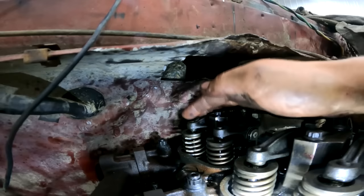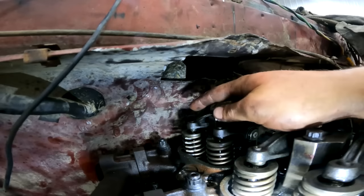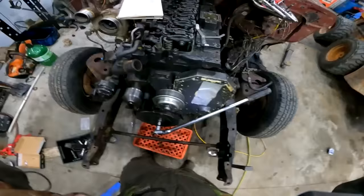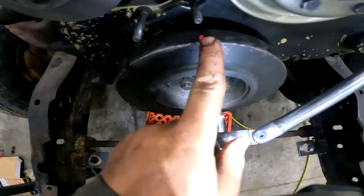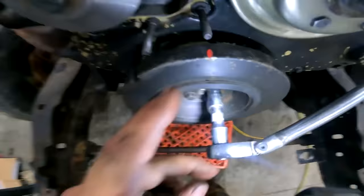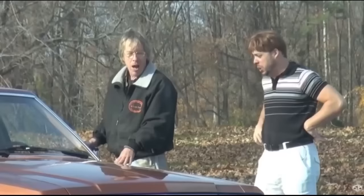The J-man mechanic, Quillen, taught me all this. He said this is where you get your scavenging or something, I don't know, he's way smarter than me. Long story short, when that is happening back there, up here, look at this. Just get a look at that. Right on the money as to where it's got to be. So this is top dead center compression on number one hole. Look at this, they're right. This is how you set your valves up.